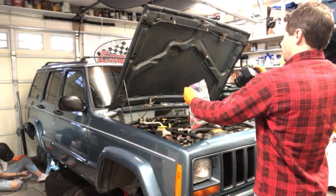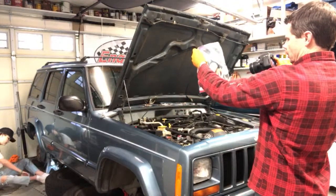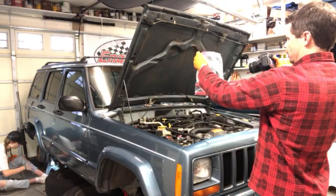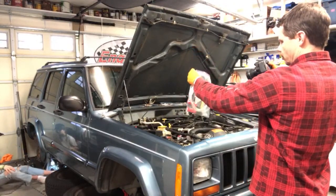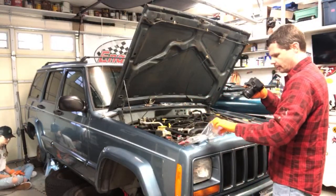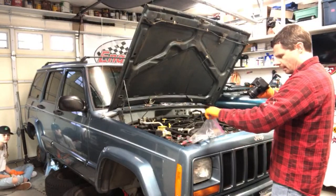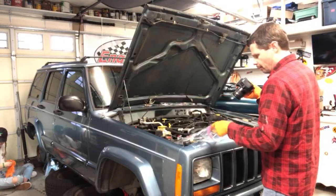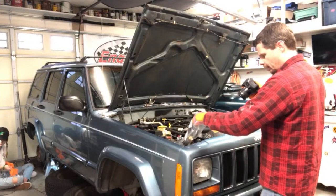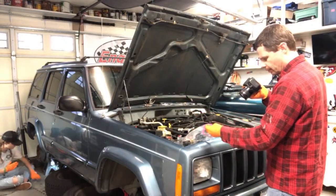So I do have a brake bleeding kit, which is super handy. It has a little pump on it, a gauge there. You can put some suction onto the brake, and you can bleed it yourself that way. But I'm going to show you the old school way because most people don't have this kit. But I will be sure to link this kit in the description, so if you're interested in something like this, you can find it.